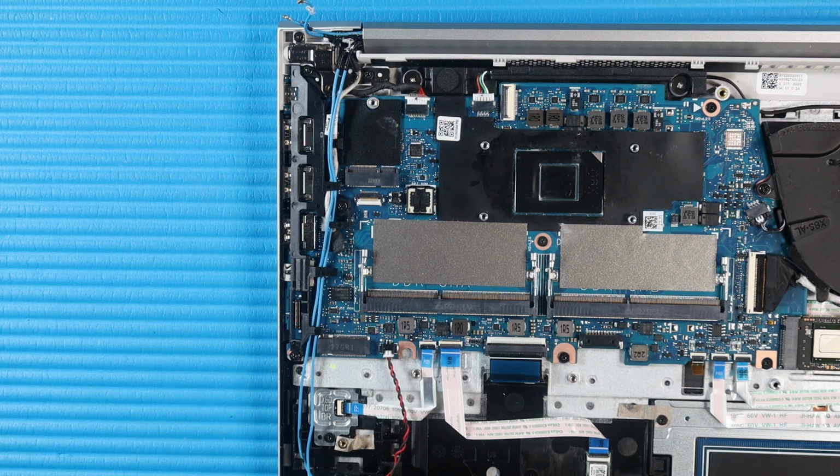Important: after a system board replacement, be sure to complete post-installation tasks as required that may include verifying functionality of the notebook, updating the BIOS, updating DMI and other settings.